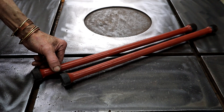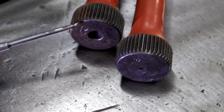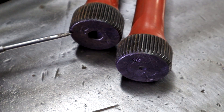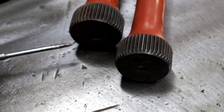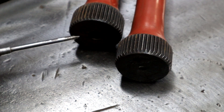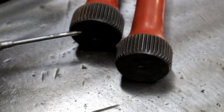I've got my two swing axle Beetle torsion bars here on the workbench because I'd like to show you some interesting stuff. These chappies are stamped here — an R for right and an L for left — so yes, they do need to go in a specific way. My best figuring would be that once they've been working for a while, they build a memory in the steel, and swapping them around might not be a good thing. Left-hand and right-hand ones need to go back in the same way.